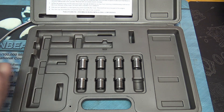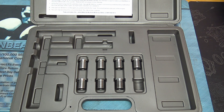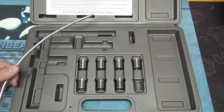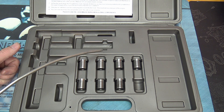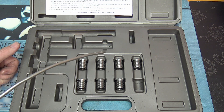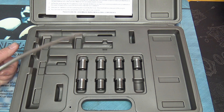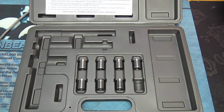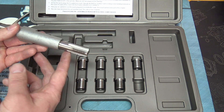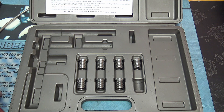After tapping, do another cleaning — use your air wand and some brake clean down in there and clean it up really well. This is the most important part: you want to make sure the cylinder and the freshly cut threads are perfectly clean — no grease, no oil — because Loctite won't stick well otherwise. Also look down into the cylinder and make sure every bit of shaving is out of there; there will be a few fine ones from the tapping process.